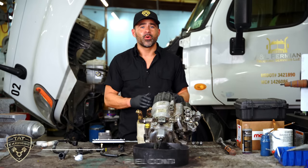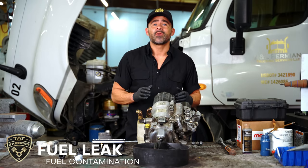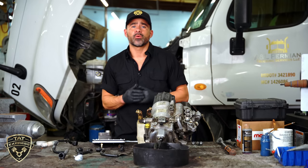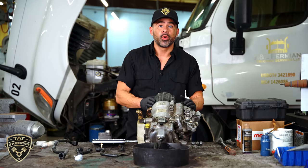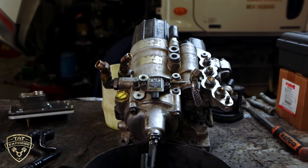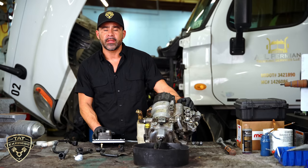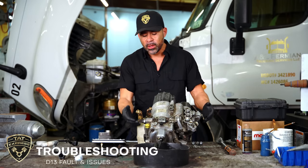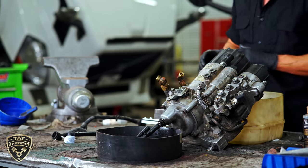As I mentioned, we have fuel going into the coolant. The difference on this DD platform is that we actually have fuel leaking on the outside. During troubleshooting, one of the things we're going to be checking is the fuel cooler. Not all trucks have fuel coolers — this one is a three-filter fuel module, which is the older style, and it does have a fuel cooler in it. We saw fuel leaking behind this module and housing, which indicates we need to check the fuel cooler.